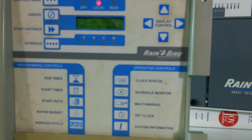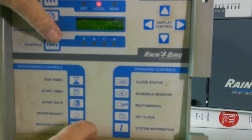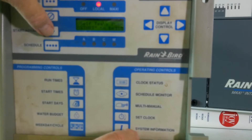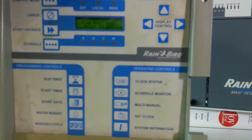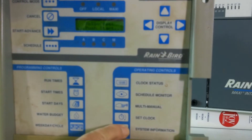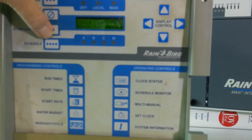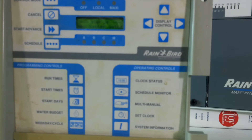First thing I want to do is make sure there's no residual information. To do that I need to wipe out the memory on the clock and set it back to factory settings. I press the system information button at the bottom until the display reads 'self-test.' Then I press start and system information in a one-two order, which kicks it into a different area and it will now read 'keypad test.' I scroll through system information looking for the readback that says 'cold start PAR,' press start, and this unit will completely reset back to factory — completely empty — and we now need to set up the program.